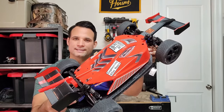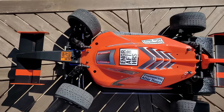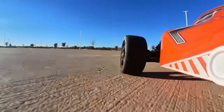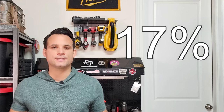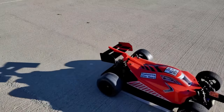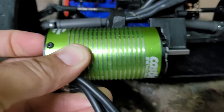After throwing the wings on we can do real-world testing, repeating the same three tests to see if we log higher accelerations with our new downforce. On the skid pad I accomplished 0.67 g's — 17% higher. On the slalom I got 1.03 g's — 22% higher. However on the drag test I got almost exactly the same value: 1.31 g's. I believe that's because the motor is power-limited at the speed where the aero is most effective, so the added drag actually makes it slightly negative. A more powerful motor would probably show a bigger benefit.